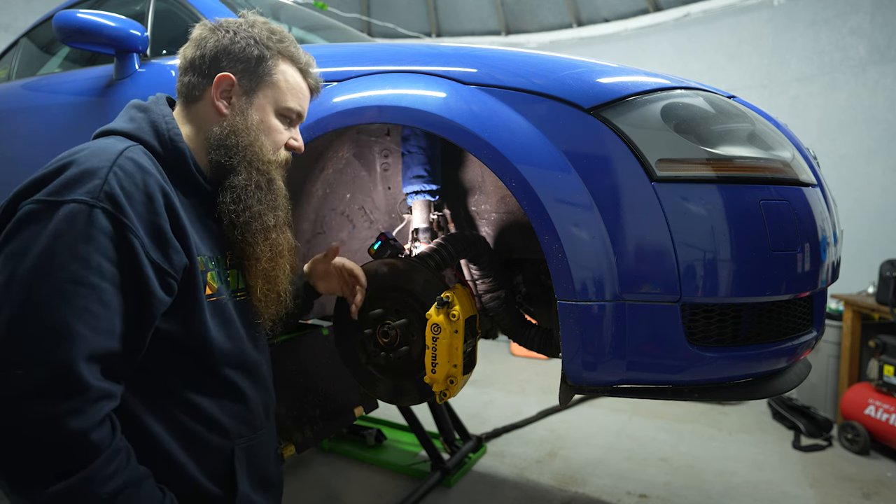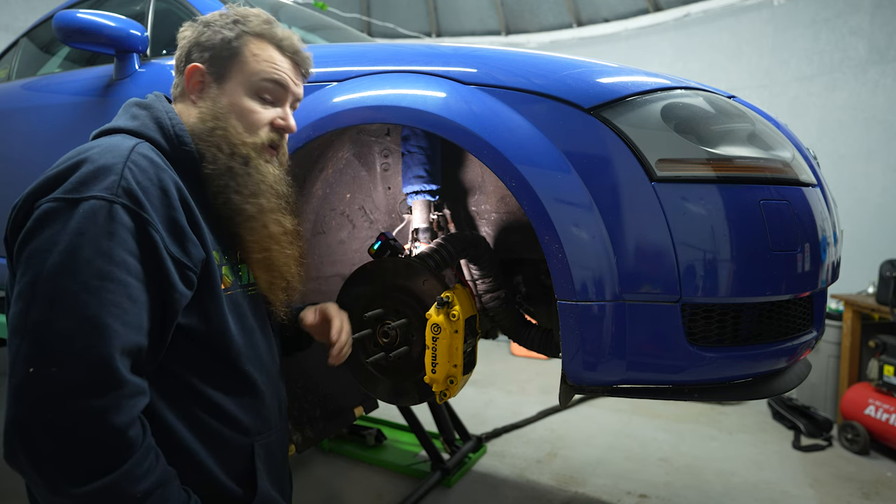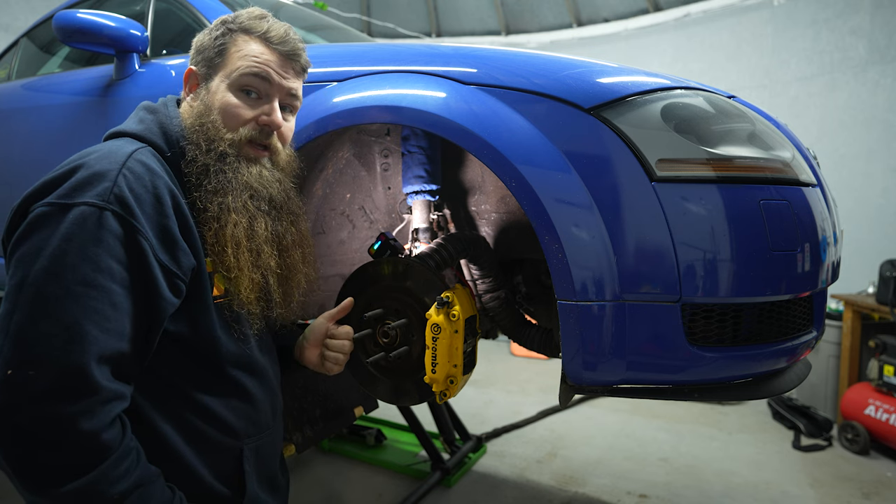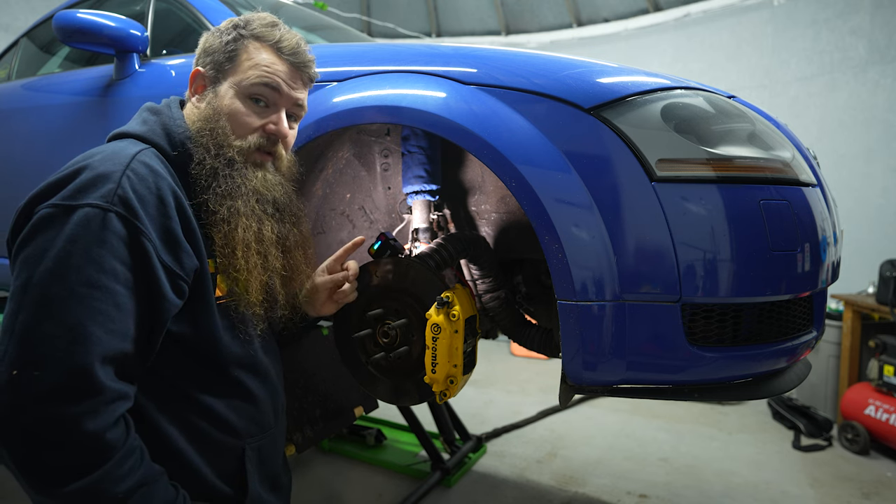If your wheels are quite in and quite close to your shock absorber anyway, be really careful when fitting coilovers. Just take your time and test fit. Worst case, it doesn't fit, you need to buy some spacers — it's not the end of the world. But most of you who watch the Parrot Bros probably already have them. I think I should throw the wheel on and then get it down and see what the gap's like.